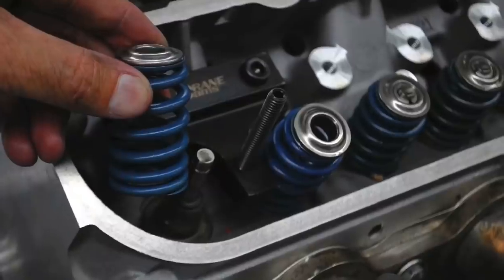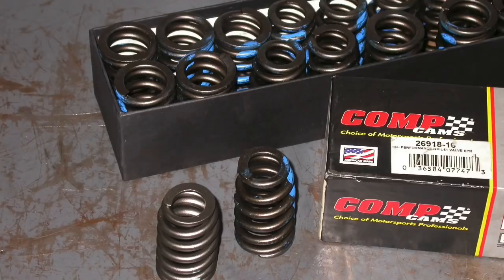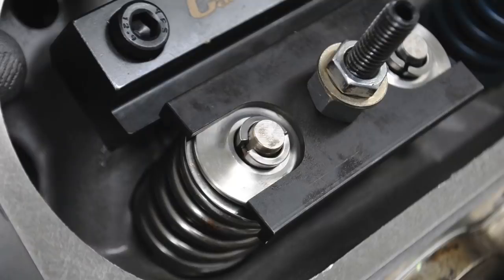Let's get to our conclusion. We compared the factory LS3 valve springs to the Comp Cam 26918 beehive springs, then compared those beehive springs to the 660 dual platinum springs from Brian Tooley Racing. Most people think there should be no change in power with a spring upgrade — and their logic is fairly sound: you compress the spring to open the valve, which takes power, but the spring stores that energy and supplies it back when the valve closes. The real question is whether the energy supplied compressing the spring equals the energy returned. Like, share, subscribe, ring the bell — I'll keep testing.